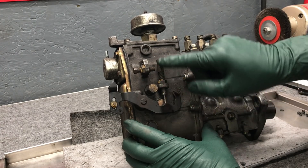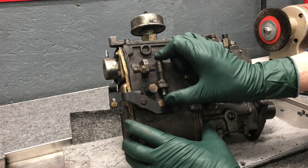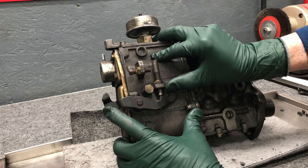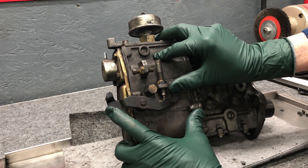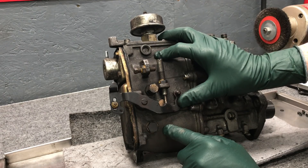You need to make sure this is moving freely, and if it isn't, you're probably going to need to replace it with a good used part. If it is coming up correctly and the engine is still not shutting off, then you've probably got something wrong inside the fuel injection pump itself.